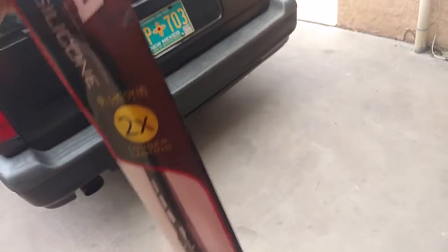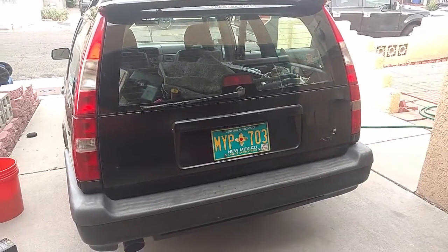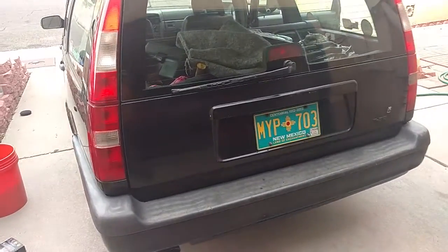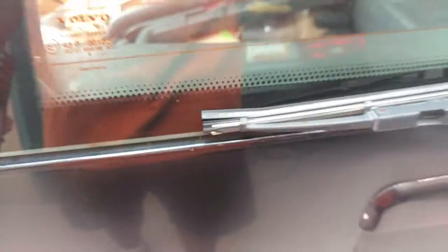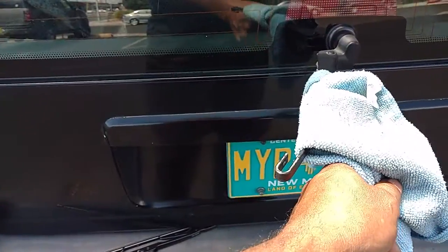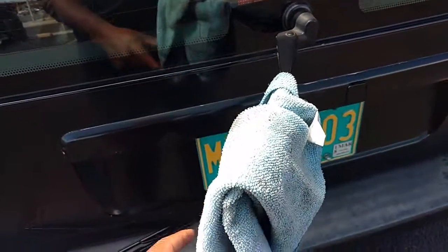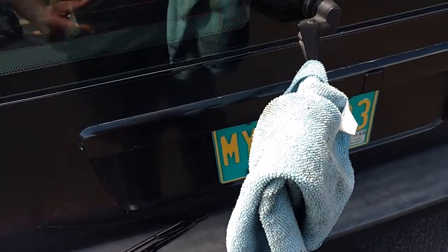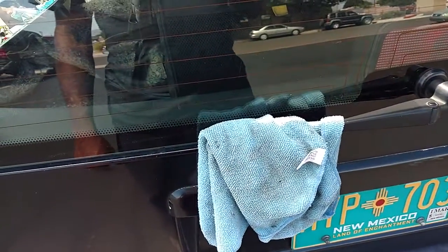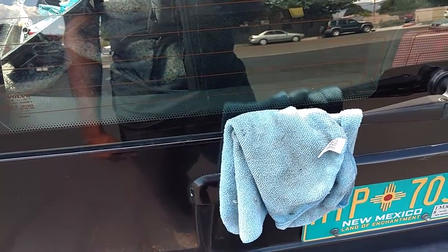So this is the brand — it's got some window prep stuff and the wiper blade in there. I'm putting it on the back of my vehicle because my rear wiper isn't doing well at all. As you can see, the tip of it is actually worn. One thing I want you all to be cautious of: whenever you take your wiper blade off, either lay it down against the glass or wrap it in a cloth. I've heard of people taking the wiper blade off, turning their back, and bumping the arm — it snaps back and actually breaks the glass. So you don't want to chip or break your glass with a wiper blade arm.